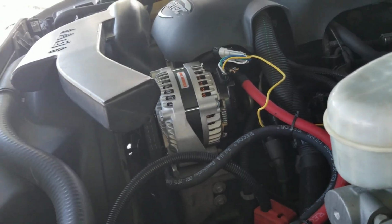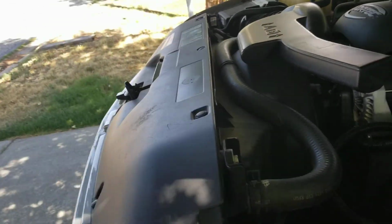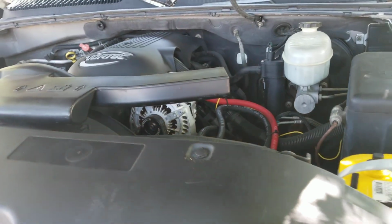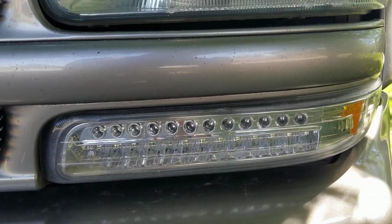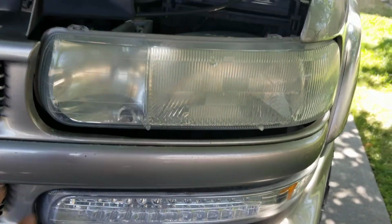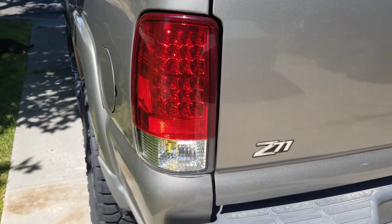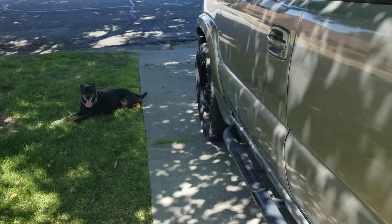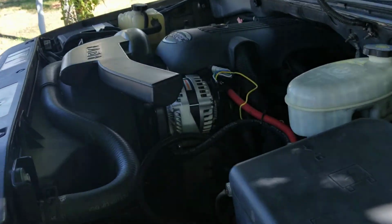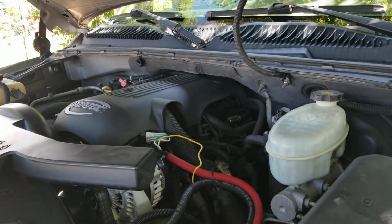The only issue that I'm still kind of having, and it's not because of any of this, but I think it's maybe from the voltage regulator on my old alternator going out, is now just my left turn signal, for some reason, it's clicking fast. And it was before I installed this. It was doing it like when they say, oh yeah, your voltage regulator is bad. I have LEDs on these lower lamp running lights and turn signals. I have LEDs in the headlights, but not the housings themselves. And then I also have these LEDs right here, and I've never had them give me any issues. I've had them on for years, and now just the left turn signal will start to blink really fast. It's almost like one of the halogen light bulbs is burnt out, but all my lights are good. So if you guys happen to know what could be causing that, it's an electrical gremlin, I'm sure. So I'm going to have to try to chase it down.